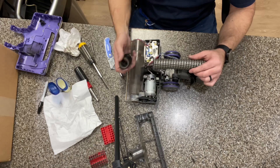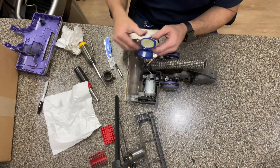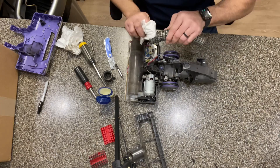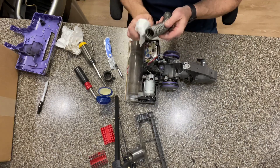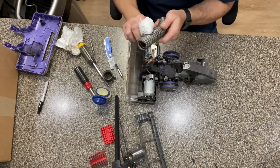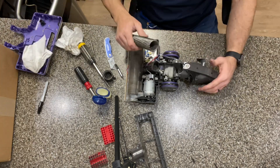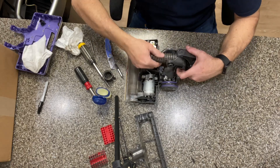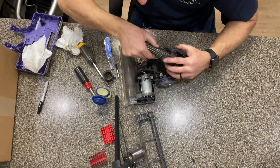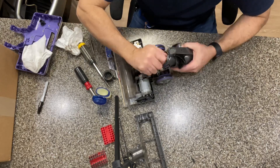The new hose is going to go in there. Pay attention to how the steel wire is wound because you'll want to screw it in the right direction. Take some Vaseline and get it on the end. I put it in the more recessed area first — I find that it's a little bit easier to get that piece in before you get the end piece on. Make sure that you're turning it in the right direction. You will feel it grab once it actually takes.